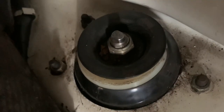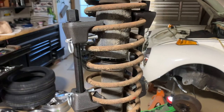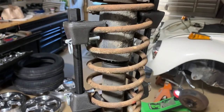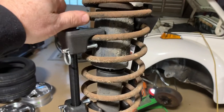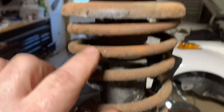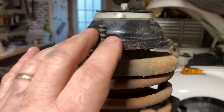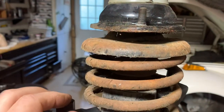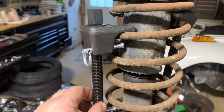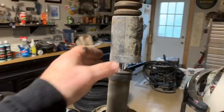We've got the strut out from underneath the car on the driver's side. We've got the spring compressors on it and we're going to give it a little torque to loosen the pressure off the spring, then take the top nut off. When you do this there will still be a little bit of coil left in the springs, so be prepared - put safety glasses on and be cautious. Make sure you get these cinched down pretty good to relieve most of the pressure on the cups.